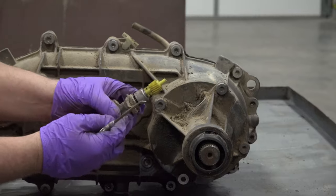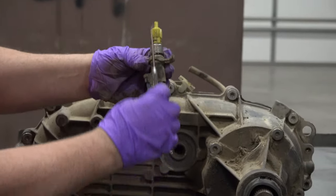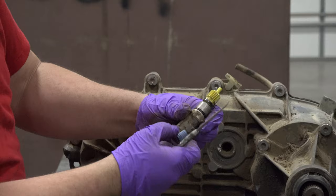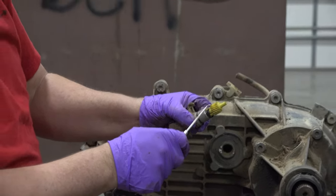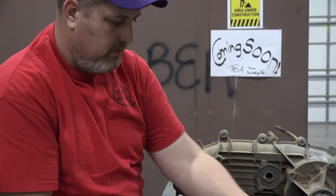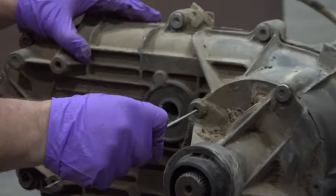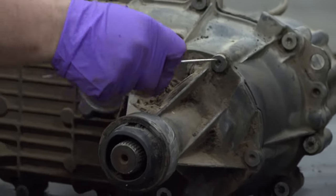So we've got a damaged speedo housing. You can see that doesn't line up straight. That got hit, broke the outside portion of the electric sender there. So this is no good anyway, but that gear right there is still something that you want to hang on to when you've got a gear-driven speedometer. So the next thing we'll do, I didn't get these ones cleaned out, I'll clean these out real quick. And then we'll take the tail shaft housing off.